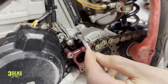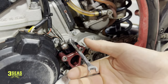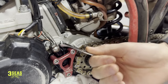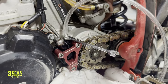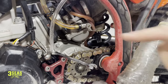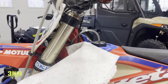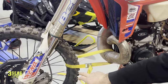I'm going to slide my 8mm onto the bleeder screw and practice with it — there is closed, and there is open. It doesn't have to go very far. Open, closed — that's plenty of movement. What's cool is if I take my homemade tool and slide it right over the top, it's going to catch all that extra fluid, and then I can monitor air bubbles coming up and out. This can sit on the foot peg. We put a towel on the shroud because this fluid will eat the plastics and graphics. I also took a strap around the pipe to hold the front tire straight, because as I come up here to fill this with fluid, your handlebars can slap side to side and make a mess.